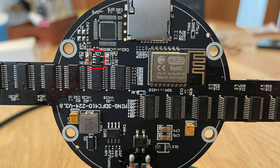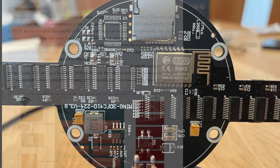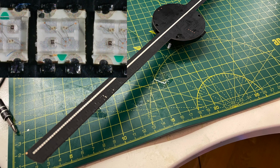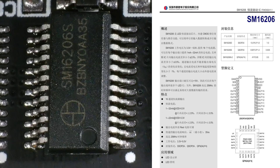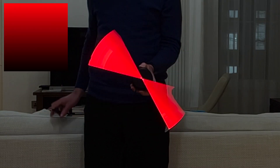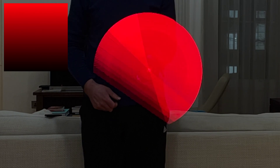There's also what looks like a 3.3V low dropout regulator for the MCU and Wi-Fi module. The Wi-Fi module is an ESP8285 and the MCU — the brains of the operation — is an ARM V7 32-bit Cortex-M4 CPU. There are 224 RGB LEDs on my version, driven by 16-bit shift registers that have constant current LED drivers built in. There are 42 of these chips in total, giving us 3 channels for each of the 224 LEDs. I believe it's using PWM to show different levels of brightness, with a limited number of shades that can be displayed.